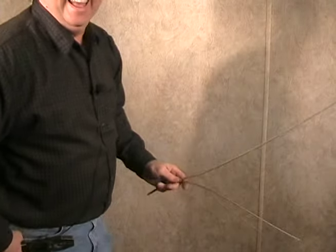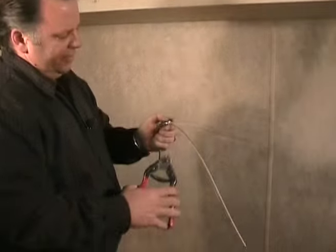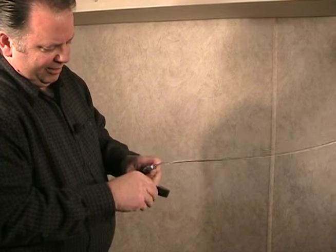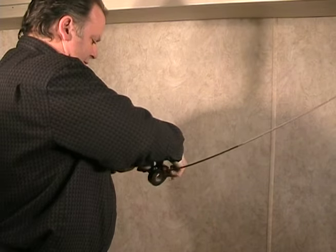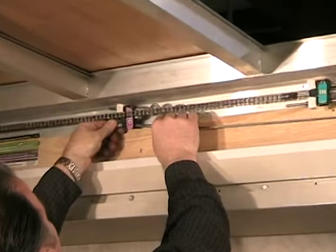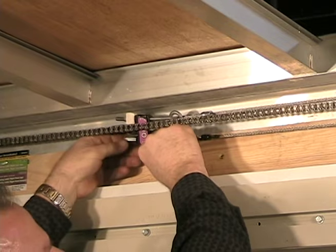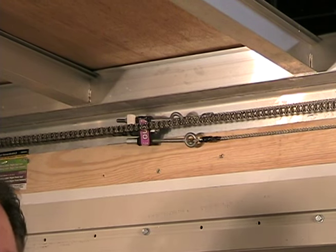If you drop the cable, go get it. Cut the excess cable off — make sure you cut off the correct side. Just for the sake of keeping your fingers from getting holes poked into them, tape off this section. Replace the stud into the bracket, and at this point you want to just basically snug it up to about finger tight, because before we complete this, we want to check and make sure the cable alignment is proper at the bracket so we don't destroy or damage the new cable.